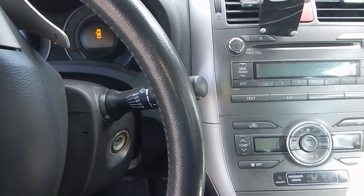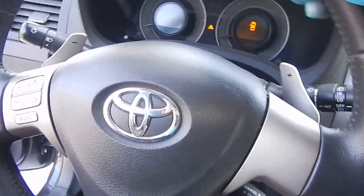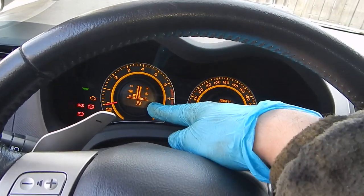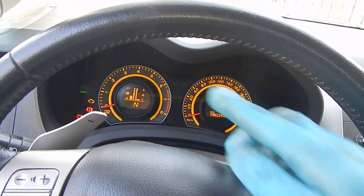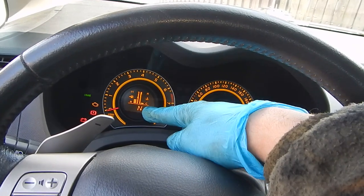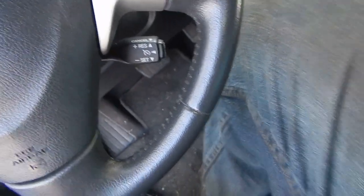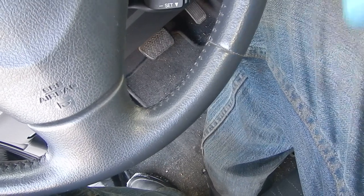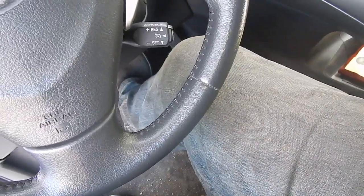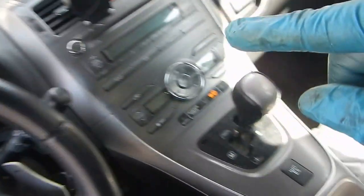Now — not pushing the brake — turn on the ignition switch. Check if I have neutral. If I do, I need calibration only for the clutch. If I don't have neutral, I need full calibration. All lights are flashing — now I need to press the brake seven times fast and I will hear some noise. A big beep — the transmission control module makes beep beep. Now I have neutral.